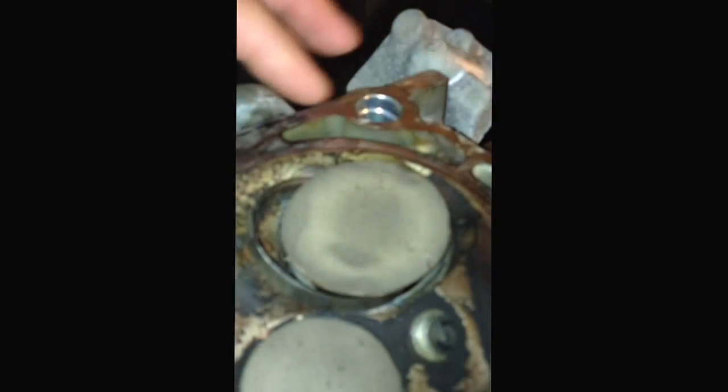So here's the offending valve. Let's see if I can get the right angle here. You can see where these pressed-in valve seats — the one here on the intake — is dislodged and jammed between the head and the valve. The valve can't return. You can see right here where it's up, and this thing is just above, or right at even with the head — a little above the top of the deck of the head.